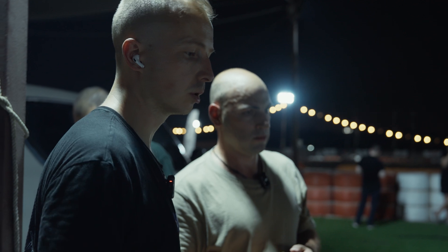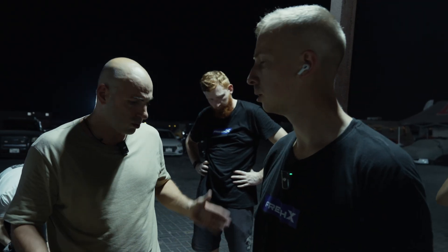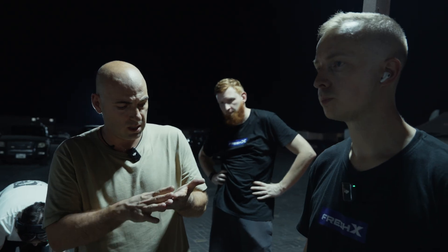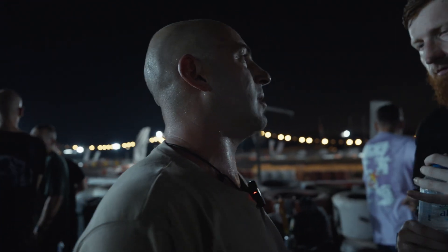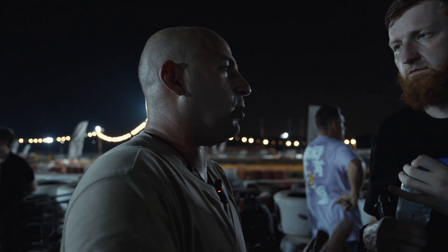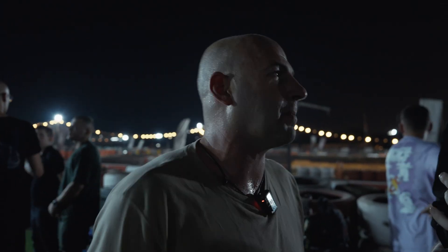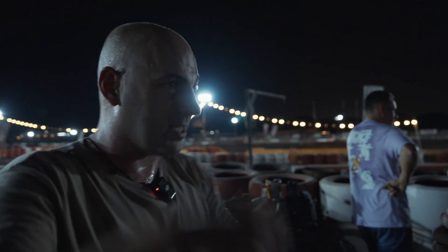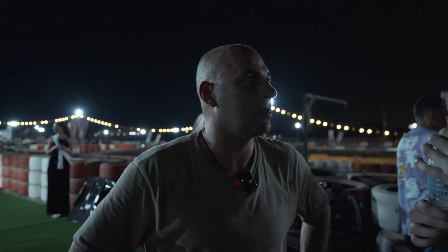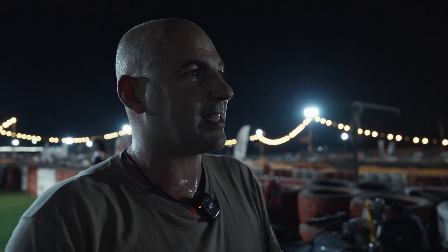35 minutes left, Tolia — be ready. We just need to bolt the wheel back on. Do we still need to work on this rack? You wanted to space it out but we haven't done anything — we only put in steering stops. We can try spacing it out a little; I'd like to test it now while we're here. It works like the stock rack, and that's fine because the car is low power. The real question is how it'll behave when you put a thousand horsepower in the back. Right now you don't have much grip front or rear, so the stock rack copes fine — speeds are low. But when everything is three times faster and grip is several times higher, then the rack will be tested. If we can make the electric rack feel the same as the stock one, we're moving in the right direction, because it will handle a thousand-horsepower car just as smoothly.